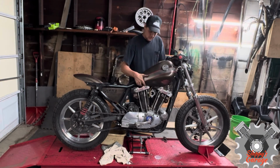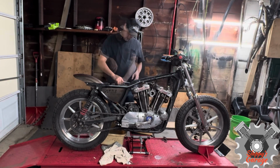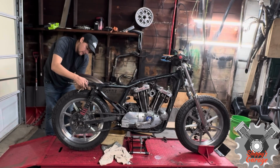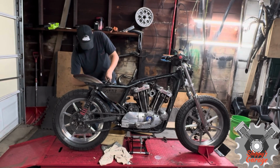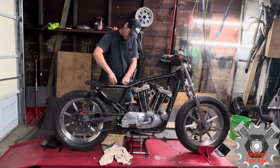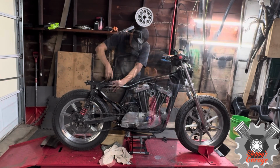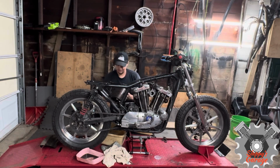And now I'm going to take this gas tank off, which is two bolts and a gas line. Oil tank: I have to remove the battery before taking the harness out of the way, which is not unplugged, it's just moved out of the way. And the oil lines have to come off that oil tank too once I take the rear fender off, because that oil tank's connected with the fender. Once all this is out of the way, I'm going to pull everything out and then focus on cleaning up the motor.